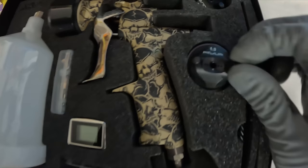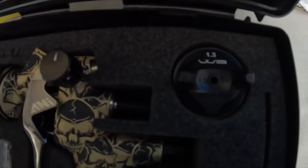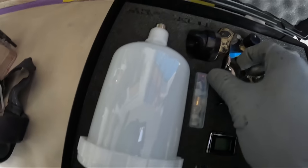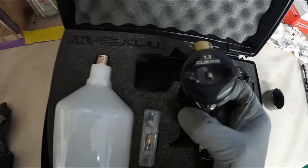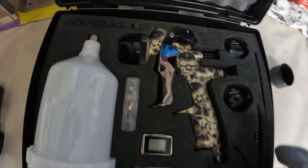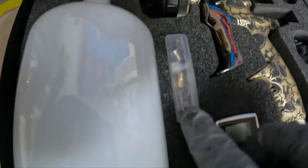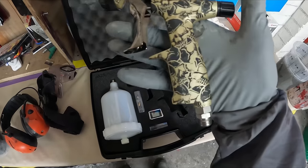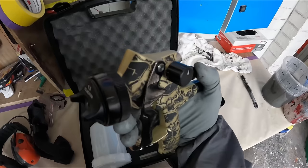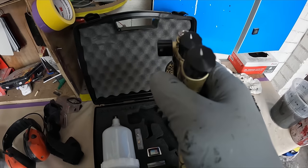I'll give you guys a look at what's in the kit. It comes with three air caps — one on the gun and two inside the box. I decided to go with the 1.3 kit, which includes the clear cap, the WB cap, and the HVLP air cap. Personally I'm not the biggest fan of HVLP guns, so I've been using the clear cap for clear coat and the WB for my waterborne base coats, and they've been doing very well.